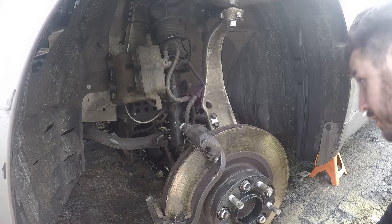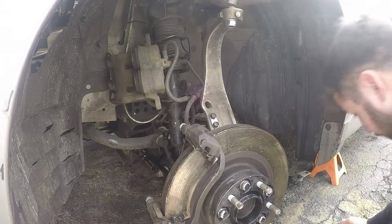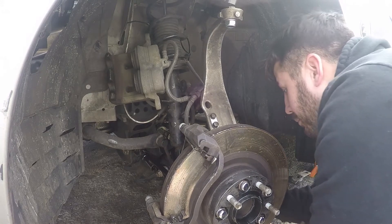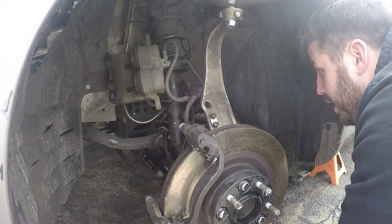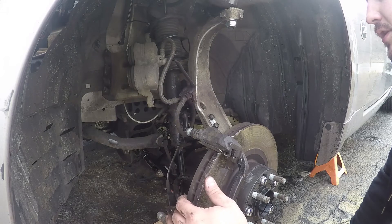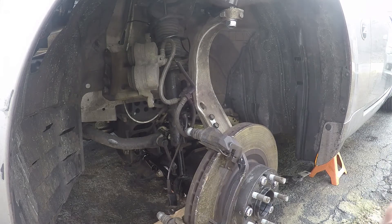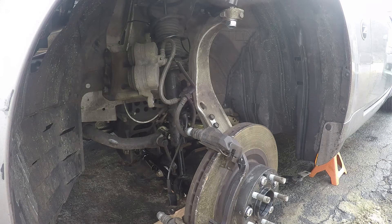Except for the tie rods, which we'll do next. I've got the new extended tie rods — took the old ones off — and we're going to have to cut the new ones to length. First though, I'm going to go through and torque all the bolts we already have on, except for the one the brace goes on, then come back and do the tie rod ends.